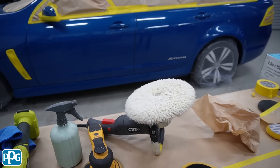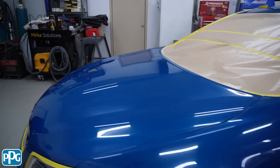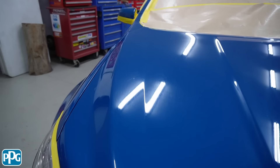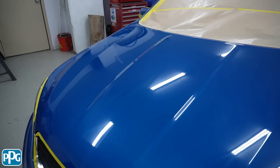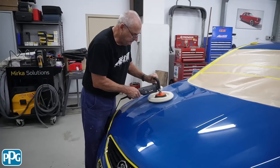I've had a go at the bonnet with the light lambswool and really wasn't having a lot of luck — it obviously has got a lot of oxidization but also a huge amount of scratching. So I've pulled the big pad out and you can see the swirl marks now. I'm not fussed about that — what I'm trying to do is cut out all of these marks, probably from when the car's been washed when it was really dirty. Because it's got no protection the grime sticks and you have to rub harder, which means you end up with marks. The big lambswool is taking out the scratches, and it just means I'll add another stage where I go back to the smaller lambswool once I'm done with the big pad.